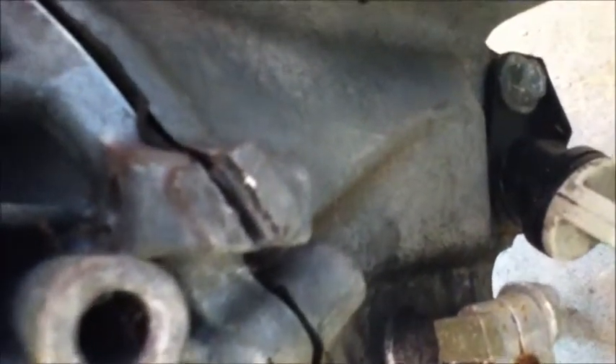I'll mar up the crankshaft right here. You're going to want to take a screwdriver and pry apart right there — I've already done both sides. It's still not coming. Take your hammer and lightly tap on the bottom of the block downwards. Lightly — this is aluminum cast — it should pop off. Let's see if we can get this open now.